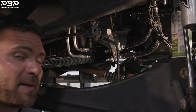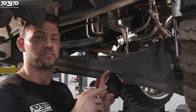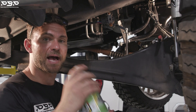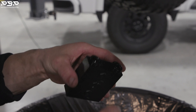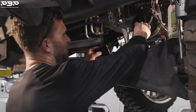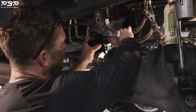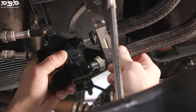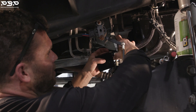Make sure the O-rings are installed in the thermal bypass and lubricated before putting it on the barbs. Use silicone lube — if you don't have silicone, clean transmission fluid works fine. Squirt the barbs down, place your hands on the back side of the barb, line up the bottom and top, and work them in with a left-to-right twisting motion. You'll feel it push onto the O-ring and seat. Top one is seated.